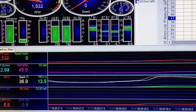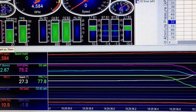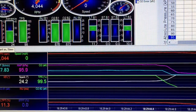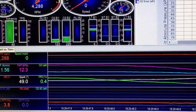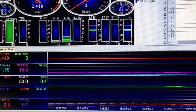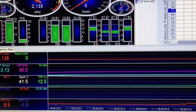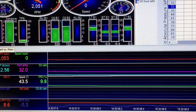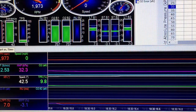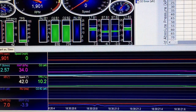With that said, I absolutely am winning between 2,000 and 4,000 RPMs. Previously, you could floor the vehicle — power enrichment TPS percentage is at 50% — you could floor it past 50%, but until you hit 4,000 RPMs the engine didn't pull cleanly, it didn't pull hard. You had a weird rush to power, kind of like a Honda VTEC, right as you approached 4,000 RPMs. Now I can get out here in first, second, or third gear, roll into the throttle, go past half throttle, and it's got a lot more power.